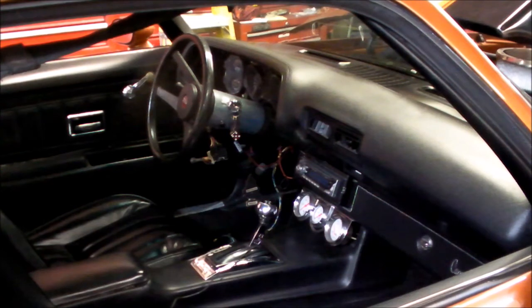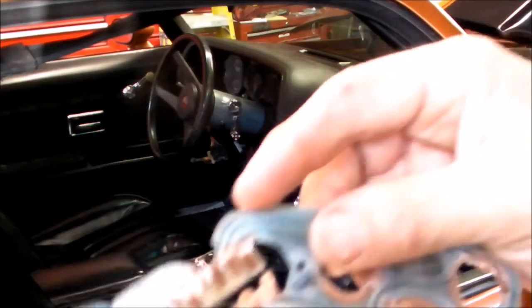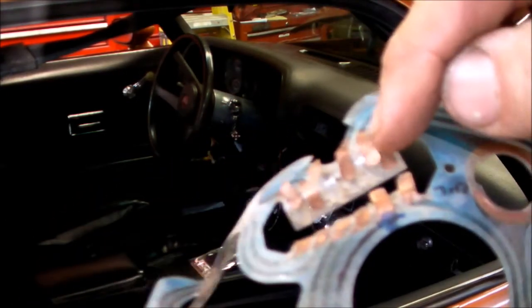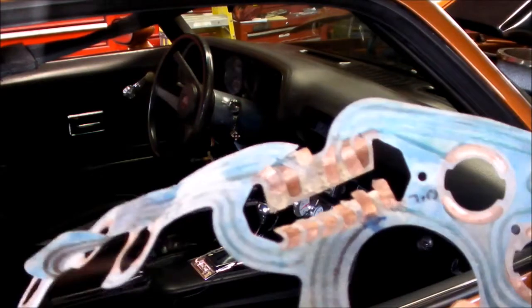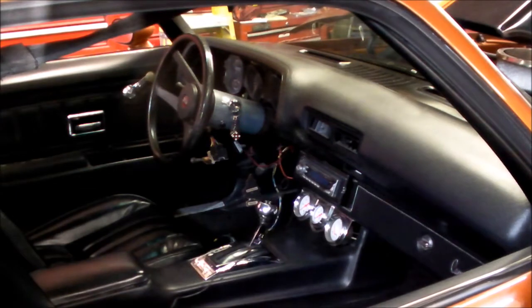and it was. Essentially, it was the printed circuit delaminated right where the harness plugs in. Kind of what this one is doing, same exact thing. That's why I replaced the other one. It delaminated, and then these two contacts were touching. One of them is the directional, the other one is the high beam indicator. So since they were touching, as soon as I put power to the directional, it was back feeding through the high beam indicator and pulsing the lights, and that was it.